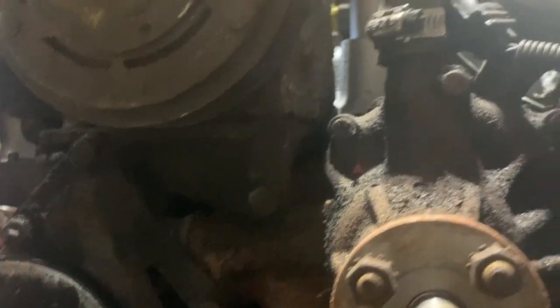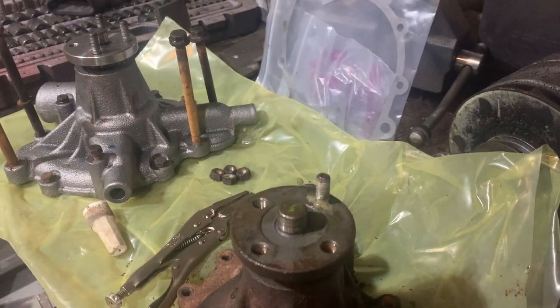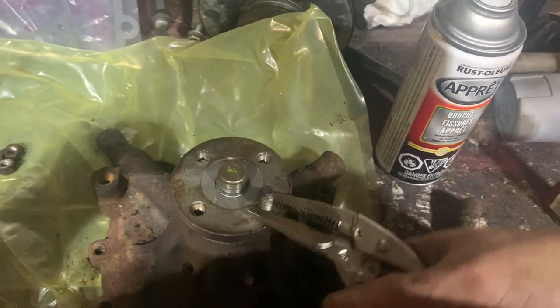Now we can get a really good look at the water pump itself. We're going to take some hoses off — there are three: one here, one here, and another one kind of hidden behind this bracket, so we'll probably have to take this bracket off to get that hose off. Once that is done, all we need to do is go around and undo all the bolts that bolt it to the front of the block. We've got the old water pump out and are ready to put the new one in, but before we do there's one last step. All these bolts have threads that can reverse out — they need to be taken off the old one and put on the new one. You can clean up the gasket that would normally go on the block, and then we can put that water pump back in.